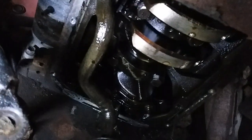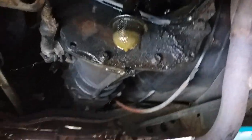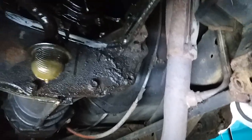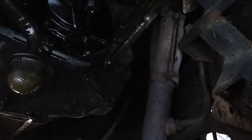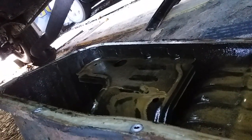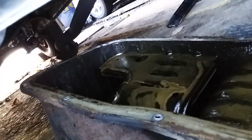I'm confident — not celebrating, but confident. It's come apart quite easy, and usually when something comes apart like that easily it means it wants to go back together easily too, or wants to live again. I'm going to coat this with WD-40, put a plastic bag underneath it so it doesn't destroy my 1800s wood floor, and my first order of business will be to get this oil pan clean. Having it reinstalled isn't reliant on me having the timing chain parts — it'll actually make it easier to get the timing chain cover back on if the pan is off.